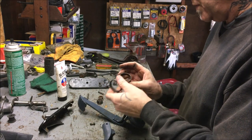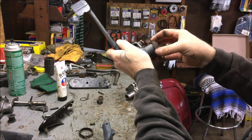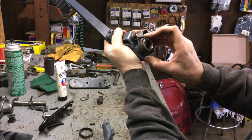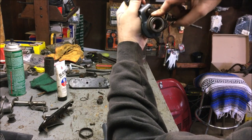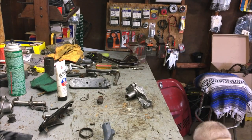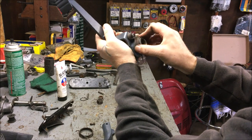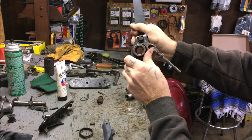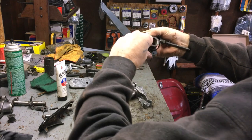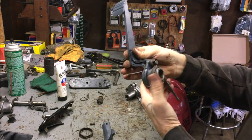Even when you put your brake spring around here, this kind of holds it in place. You're going to put your brake spring on — it's going to hook right on there because you have an extra slot on this. What happens is this goes to the floor. When you push your brake, that goes against your floor, and that gives the tension for the brake pedal to come back. You've got to have this on before you put it on the shaft.